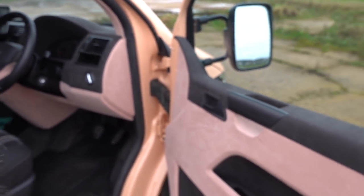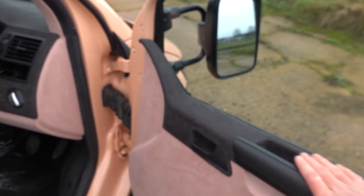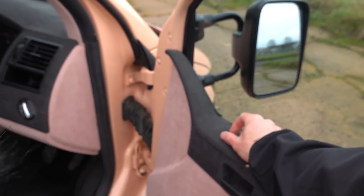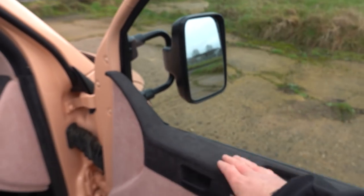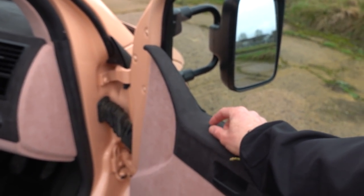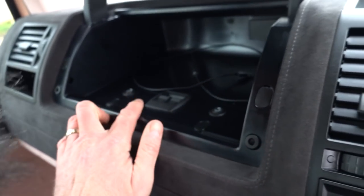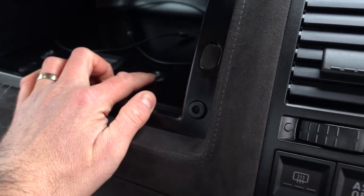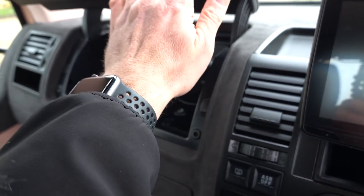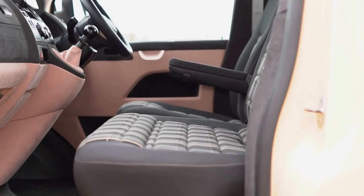The upper pocket's been done, even the light switch has been done. It's definitely not going to be to everybody's taste but I absolutely love it. Originally this had electric window switches and door cards with the adjuster for the power folding mirrors — which this vehicle obviously doesn't have — and that always bugged me. So we decided to smooth them out and remove the electric window switches, and they've been put inside the glove box. Now we have electric window switches — left and right — in the glove box. We've also got heated seat switches, so we've added heated seats to the driver and passenger seat.